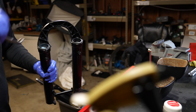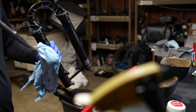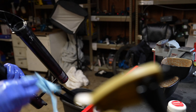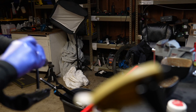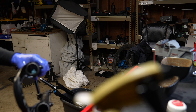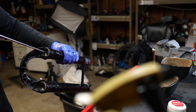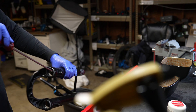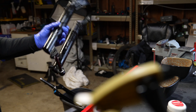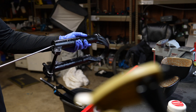To clean the lower legs, spray alcohol into them and then pack them full of blue paper towels. Pull the paper towels back out — you want quite a bit of friction inside the lower legs so it squeezes all the grease and dirt. Push down, flip it around, push it back, and get a long set of needle nose pliers to pull the paper towel out.